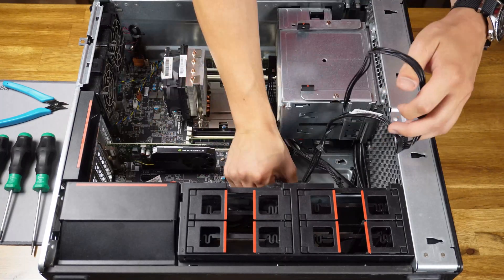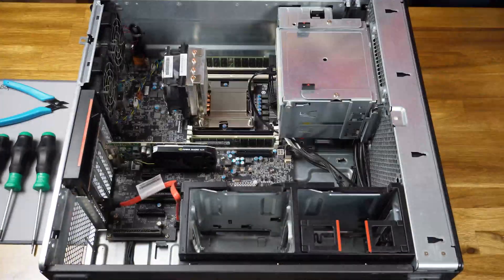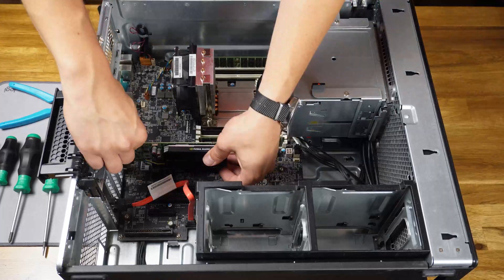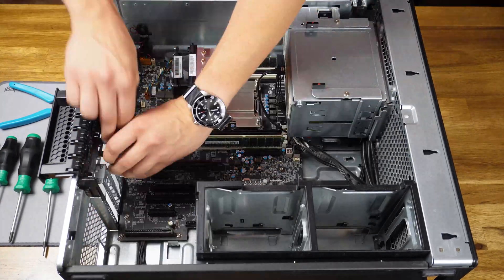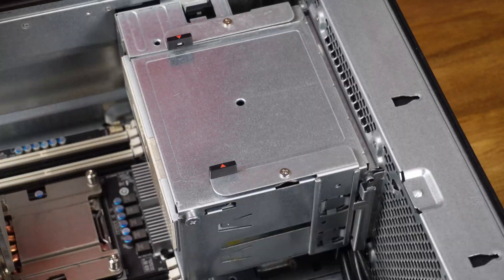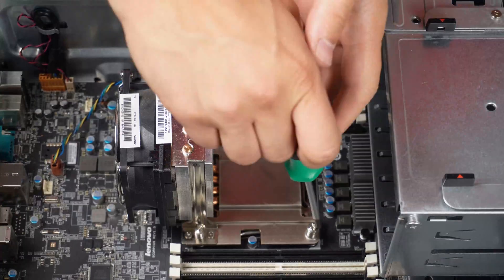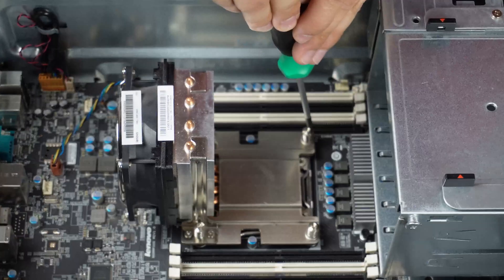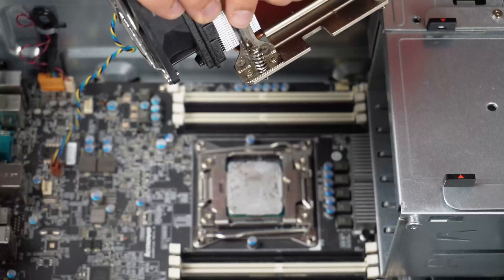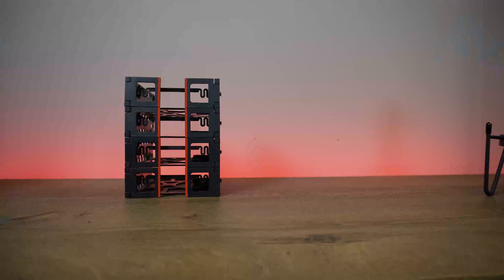So I disassemble everything starting from the SSD, the power supply and the hard drive base. Next, I remove the rear exhaust fans and the GPU and eSATA port. I remove the two memory modules and the optical drive. The CPU cooler has an interesting form factor as the heat exchanger is offset from the center of the CPU socket. I take out the optical drive bay and the front I/O cables so that they don't get in the way.